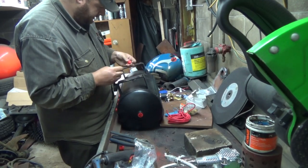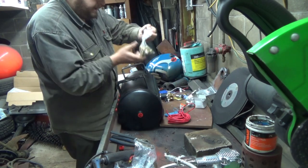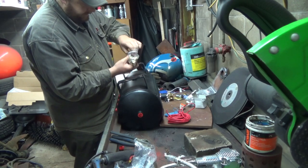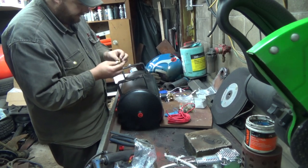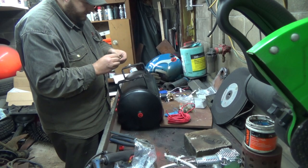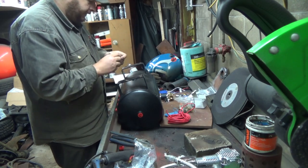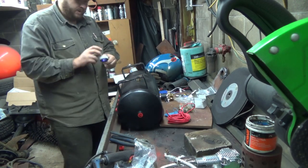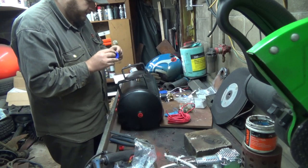And interestingly enough, that hole's a bit too big for this drain plug, so they must have an adapter dewey here somewhere. So that's good. I don't like that because now you've got two things that are potentially going to leak on you. But that's the way she works, I guess. So that fits good there. Okay, so we'll Teflon these. You can do that, or you can use that pipe dope stuff that you put on, and it's like a liquid stuff, like a toothpaste almost.